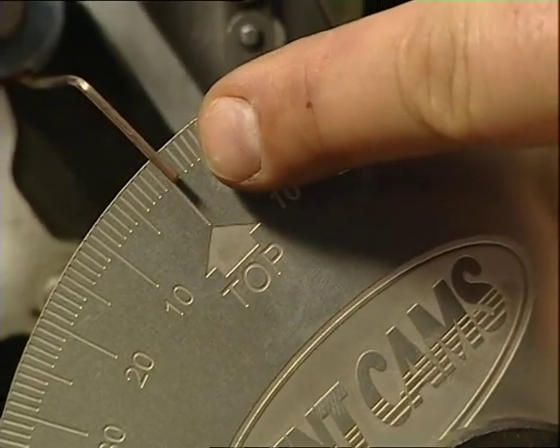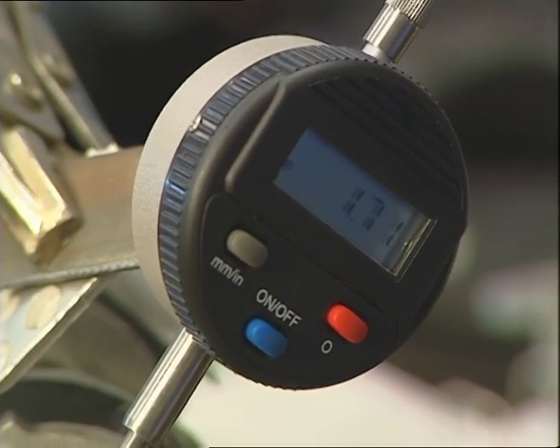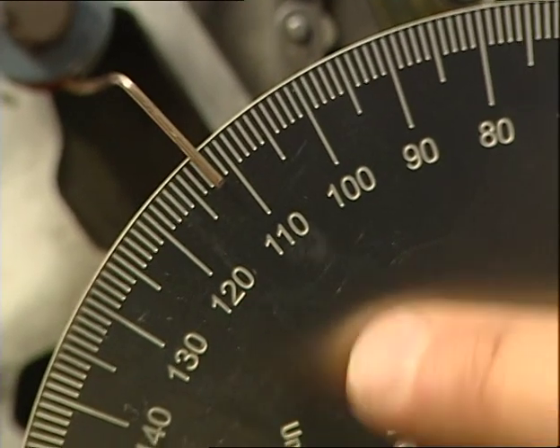What we've done is set up piston one at top dead centre and set a marker down here with a bit of welding wire on our gauge disc at TDC. Up here we have a dial gauge set up on the inlet valve rocker for cylinder one. I'm going to turn this round and watch for the numbers increasing on the dial gauge as the rocker starts to move up as the valve opens, then find out where it's at its maximum lift. When that valve is at maximum opening, it's happening at 112 degrees after top dead centre. According to the camshaft specs, we need that point to be 108 degrees after TDC — so at 112 degrees it's happening too late. To advance it, all I've got to do is undo these four bolts with a little allen key, then get hold of the nut on the end of the camshaft and give it a little nudge.